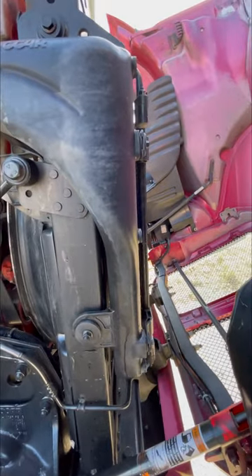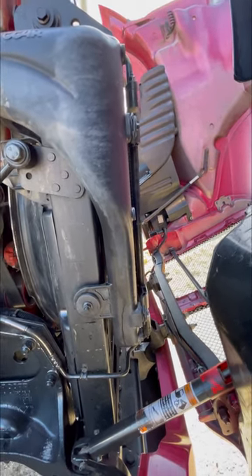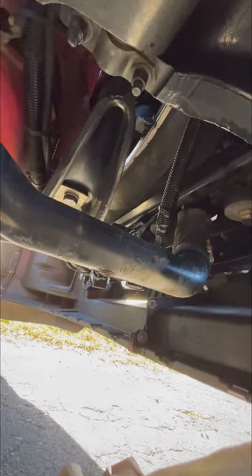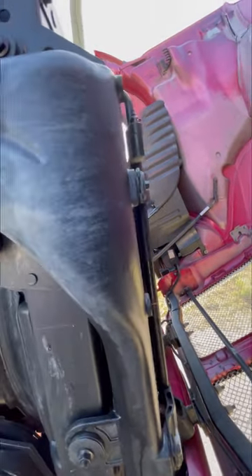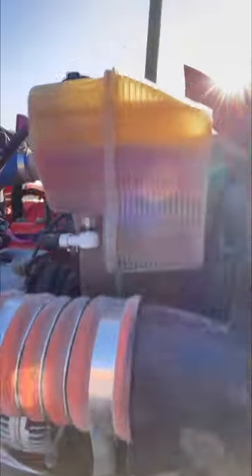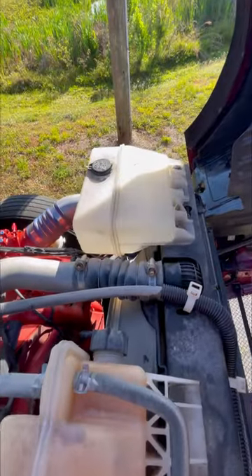It's going to be a big job. I'm in the process of taking the radiator out. First we're going to drain the antifreeze — the drain plug is right here on the bottom with this big two-and-a-half-inch pipe. Then we'll be taking the AC condenser, intercooler, and then we'll get to the radiator. We'll also be removing the antifreeze tank and the windshield fluid tank.